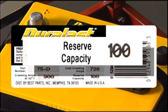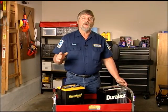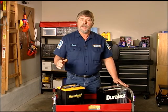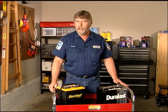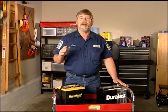When choosing a new battery, in general, the higher the number the better for both the CCA and the RC. If you live in a cold climate, the CCA rating would be more important. A good battery will last up to five years, and that's about the time since the one in our vehicle has been replaced. Now let's discuss the tools you need for the job, and then we'll show you what to do when you have a dead battery.